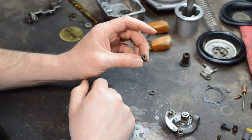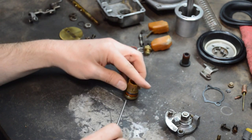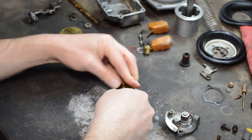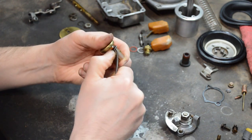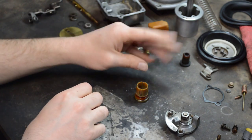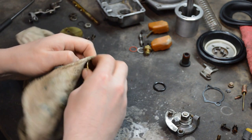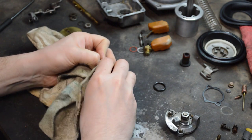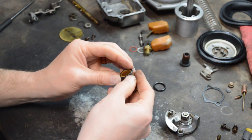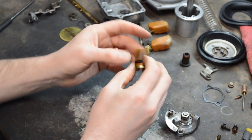This o-ring is what keeps oil from leaking out of the dashpot, so that's important. There's another one right here — I don't know if this carburetor was leaking, but I'm going to go ahead and assume that it might have. This one fits at the bottom of the float bowl. This one might have sealed just fine, but either way you've got it apart and you don't want to take the carburetor out again.